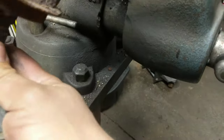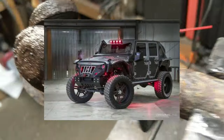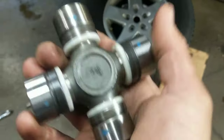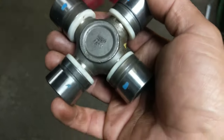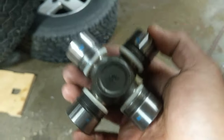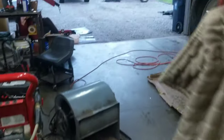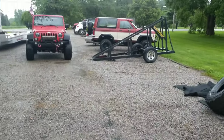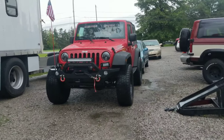I've seen them actually dust — this bottom one that's wiggling like that, that's probably all there was in there was dust. So if you're an average driver, maybe you don't even off-road your Jeep, your truck, your Toyota — I definitely like the idea of greasable for that type of person. Again, if you need the strength, maybe you need a Dana 60 anyway, but the not-greasable is probably the way to go for you. But my opinion: I've come to like greasable more for your average everyday person. Give me a comment below, I would love to know what your thoughts and experiences are. Share a story below. We'll see you guys out there on the trail.